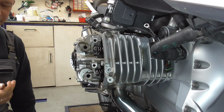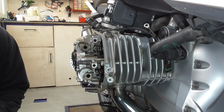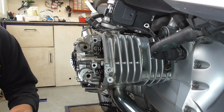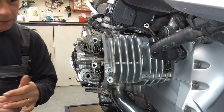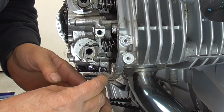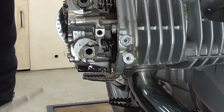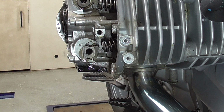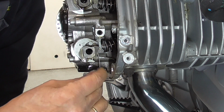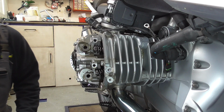Now we're gonna see the outlet valves. I can assure you, those are all in spec too. Now, then we start, where is my, this is 0.35. And then we're gonna do it. Oh, picky day. 35 goes. Then we take my other set, I think, and there we have 36. Hopefully you could see that too. 36 doesn't go.